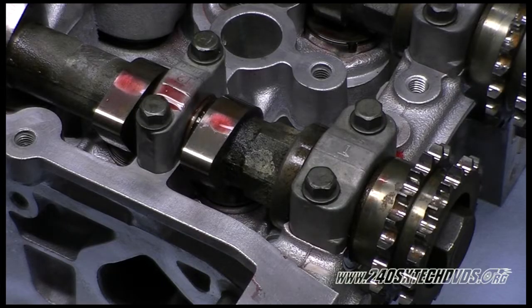The reason why we're going to check the valve lash on the head off of the motor is because I want to show you how to do it off the motor, just in case you ever need to do it. Because when you do it, it's a little bit of a different procedure because you have the timing chains installed on. But we'll go over that in the next video, part 4 of the motor build video. I just want to show you for this video how to do it now off the motor.